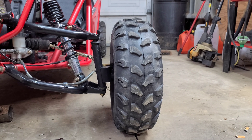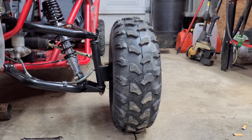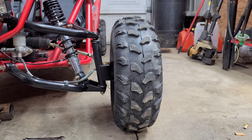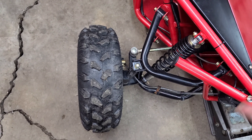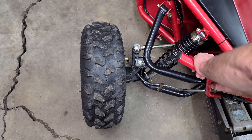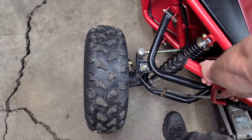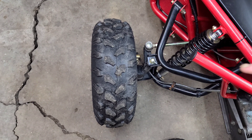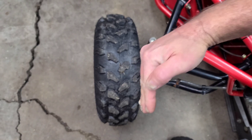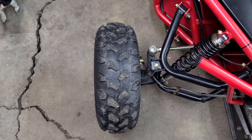You just don't want it to steer when you push down on the go-kart. Let me show you the bad side one more time — I'm gonna push down on it and watch the tire. You see it turning? Turning to the right on the front of the tire. Now let's do the other side — the side we fixed.